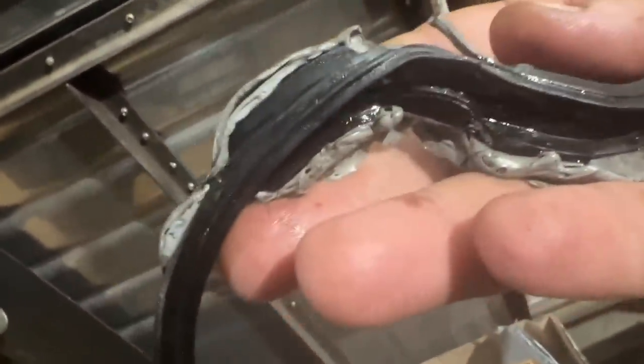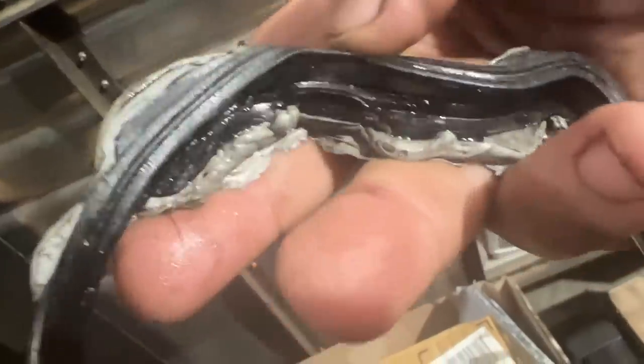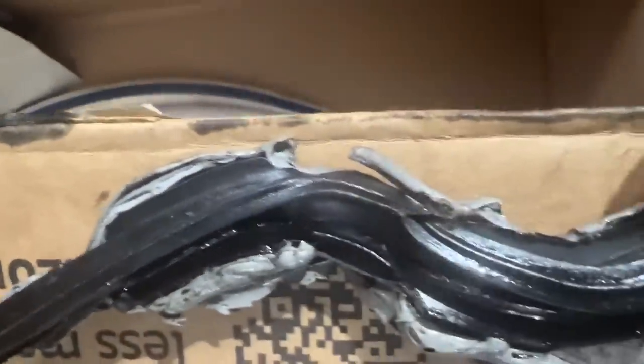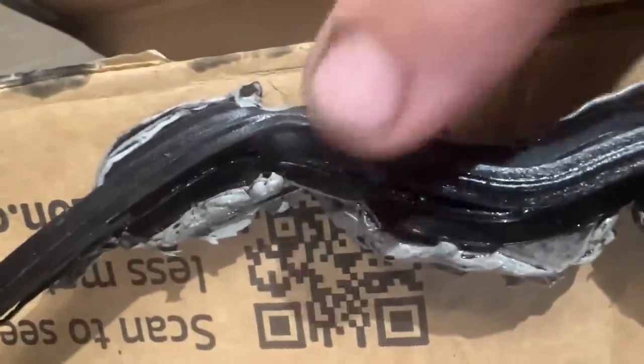So he just had this oil pan gasket on a Series 60 replaced. And we said it's leaking from the oil pan gasket, but he just had it on. But you can see what they did here. This corner was rolled out. This is where you put the Permatex on the seam of the engine block there. But the actual gasket, you can see this here. See where it's rolled out here? And that's where it was leaking at. It was supposed to have even a raised ridge, and then it was pushed out and cut. Right there.